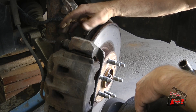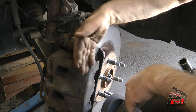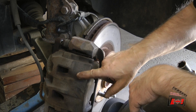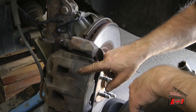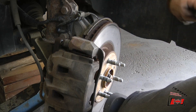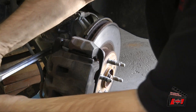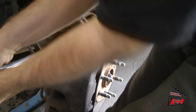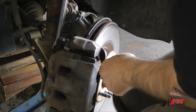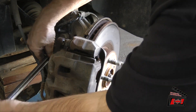So here's the process: I took out the caliper bolts and backed off the pistons, but I cannot get the caliper out of this assembly without taking it off the vehicle. So the next step is to remove the carrier bolts — those are 18 millimeter. I'll use a swing arm to break those loose. Got to use a six-inch extension to reach the top one.